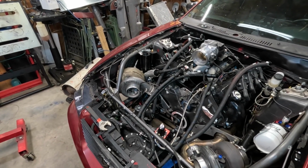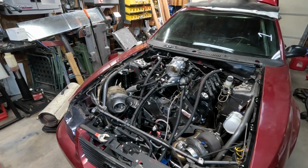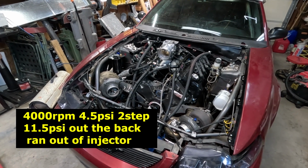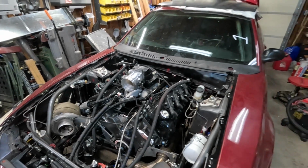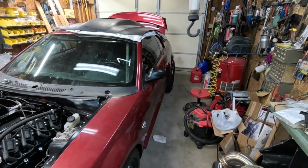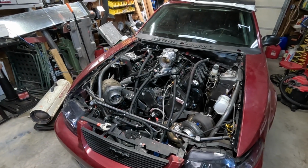But of course, you can never leave good enough alone. The one time that we were able to get it out this year, made 4 passes, and on the last pass of the night, we were able to bust off a 9.34 at 148. So considerably better than what we were able to do on the old combo. We made some adjustments on the rear suspension, went to a 28-inch slick versus the 26 that it was on, and you know, it worked out pretty good.